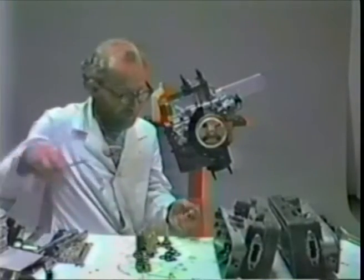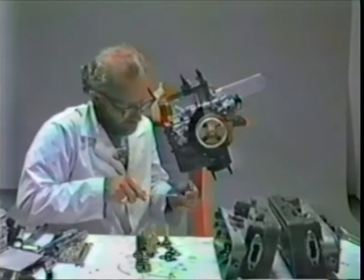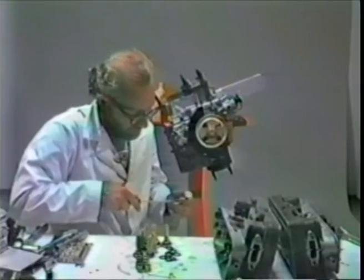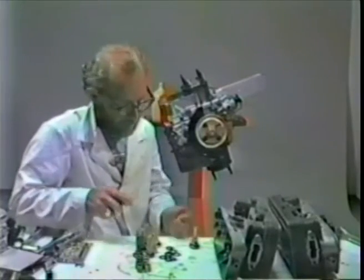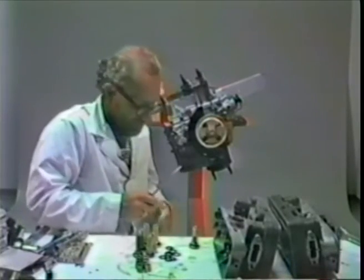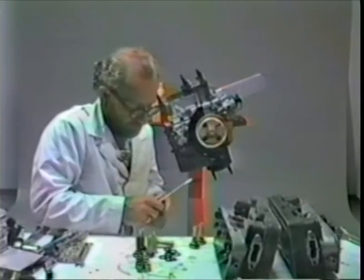Okay, now we really should have taken off the head bolt washers, head nut washers, before we plated everything. But if you're careful with a screwdriver, you can pry off the old seal. If you're not careful with a screwdriver, you'll end up stabbing yourself in the hand. Should have taken these things off before we plated everything. But sometimes in the excitement of doing an engine overhaul, you forget to do the little bitty things. But it doesn't matter if you do get them back after they're plated.